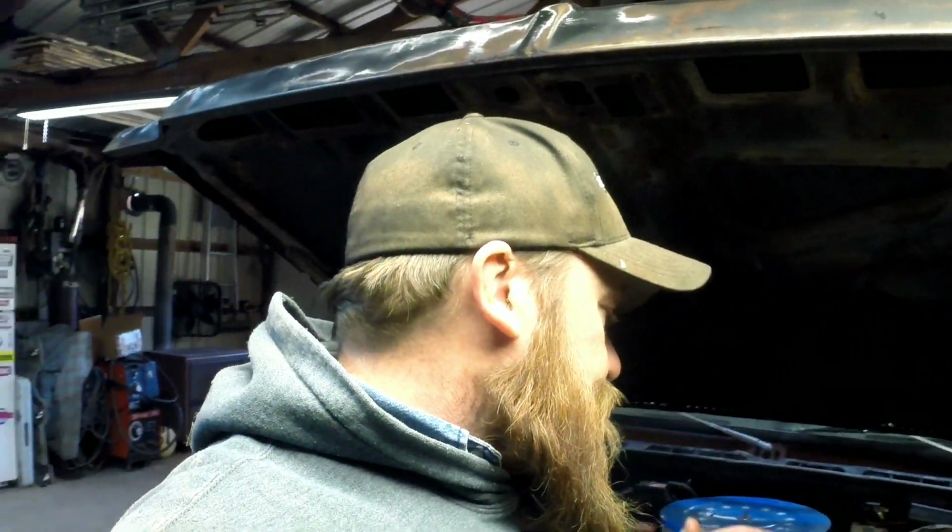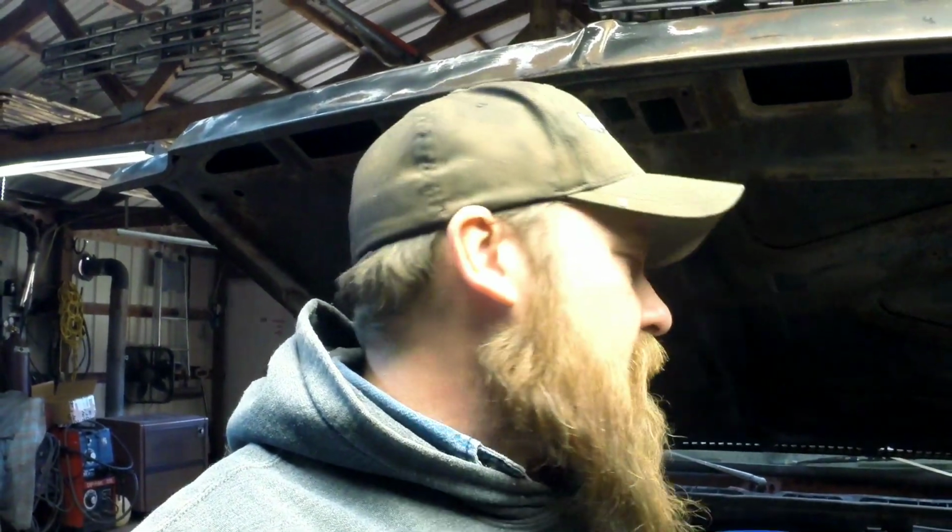He wasn't really running the greatest. Had a couple plugs fouled out. This thing is worn out. I think that's the only reason it's surviving the nitrous hits. So I put a couple plugs in there, and he's running better. So I'm going to set the camera up behind the truck, get a little sound bite of the exhaust that's on there right now, the 3-inch pipe with the 8-inch glass packs, and then I'll put the extensions on there, get a sound bite of that.